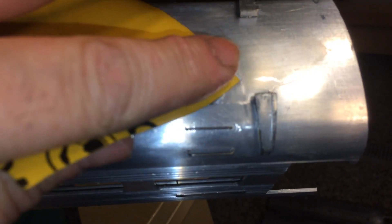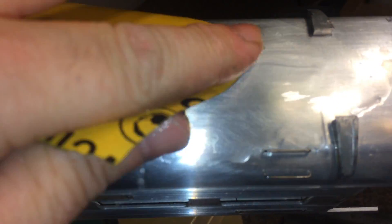There's another area right here — you see right above the light — that could use some work. Once again, let's just take our wet sandpaper and work that area. Now that big scratch is out, I see we put more scratches in, but we'll remove those with finer grits of sandpaper as we go along. See, I'm not pressing particularly hard — sometimes you have to — and you always try to do it with the grain the way you're going to have to buff it back out.